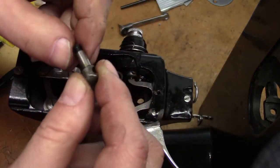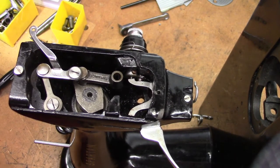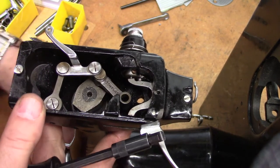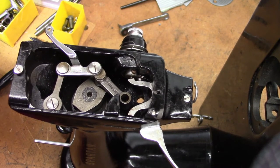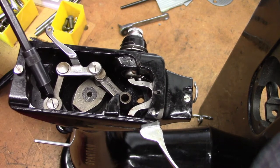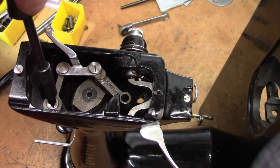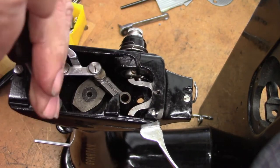We're also going to take off the clamp. Now on this particular machine, the 192, a couple things you need to know: so far all the screws have been standard right-hand thread — that ends now. This screw and this screw are opposite-handed. Instead of righty-tighty lefty-loosey, these are righty-loosey lefty-tighty. Singer did that, and mechanically it makes sense because of the direction the machine turns. So just remember, turn those clockwise to loosen them.